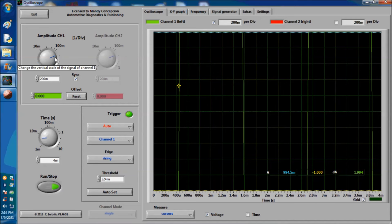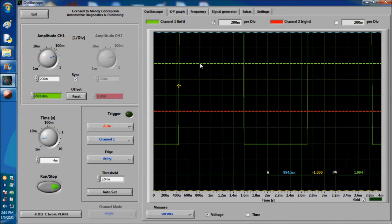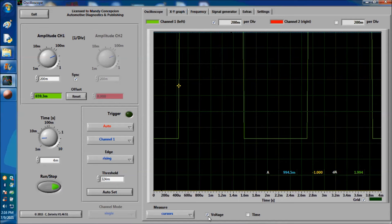Now we're expanding the signal so that we could do a better explanation of what's going on here. Basically, we're going to move the ground, the zero line, a little bit further up so that we can show you what it means. Again, as you can see, now the gap is even greater, not because of anything in particular. We changed the amplitude and moved the signal upwards so that we can show you that gap between ground, which is the yellow line, and the bottom part of the waveform. As I said, this cannot be. If it's 20 millivolts, it's already starting to be a problem.